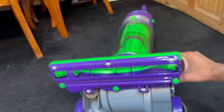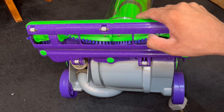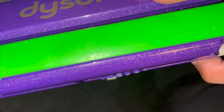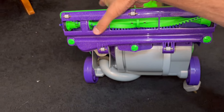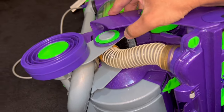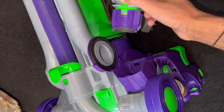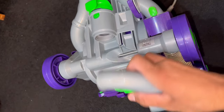At the base we can see the brush bar — relatively soft bristles, very slightly stiffer than the DC01 bristles, and they stick out a little bit more than the DC01, which is good to see. We've got nice rubber roller wheels intact — great sign. The clear internal hose is actually discolored for some reason. Here we have the rubber wheels and the airway inspection ports showing the removable valve pipe for blockage access, plus the U-bend on the back.